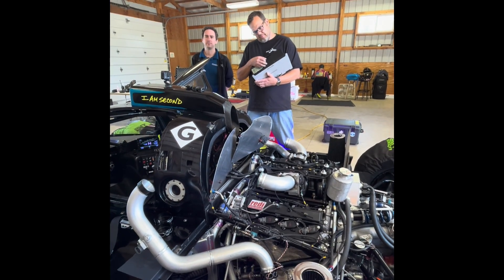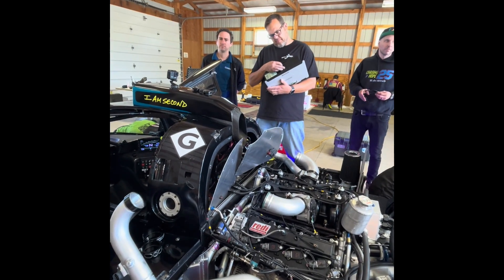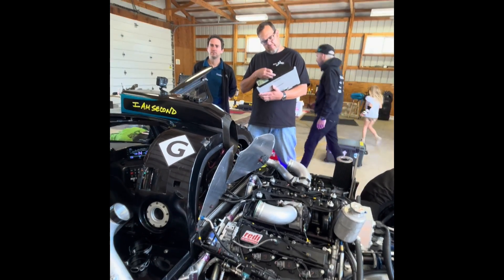So the first in-and-out lap and it's got a low fuel pressure warning alarm. We're trying to wire the CAN bus into the Injector Dynamics fuel pump controller so we can try to diagnose why we've got a low fuel pressure alarm. On top of that, we're trying to figure out if the active aero stuff is really working or not, because looking at it on the racetrack it doesn't look like it is. There's no feedback into the MoTeC — it's its own standalone system, which is great, except you can't tell if it's working. Kevin, you're going to hook up the CAN bus from the BPC 100 to the dash so we can log the channels over CAN?